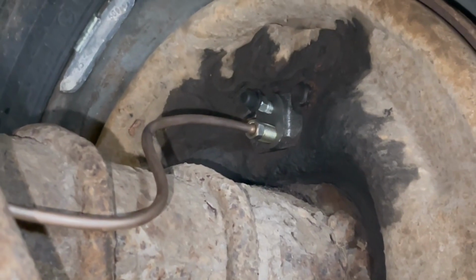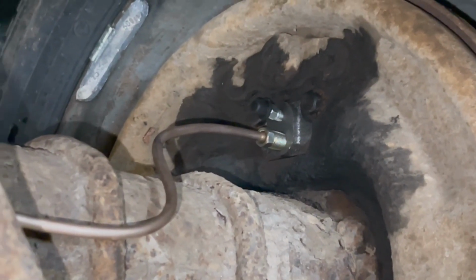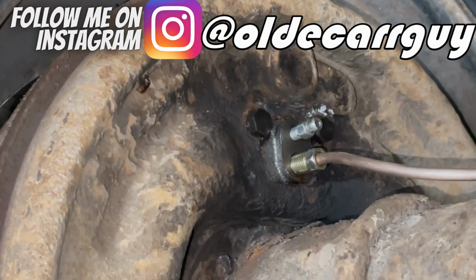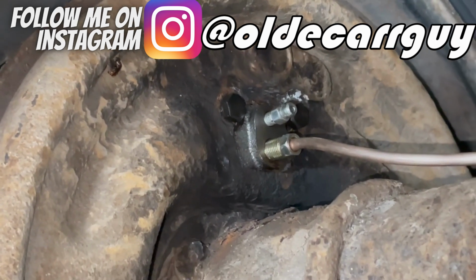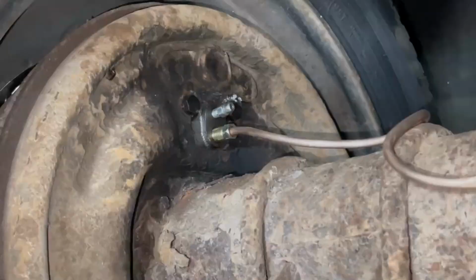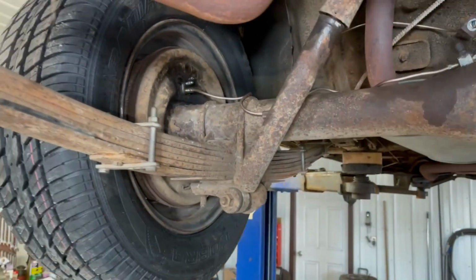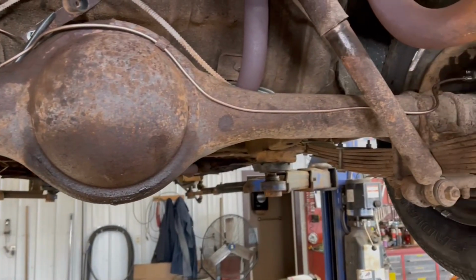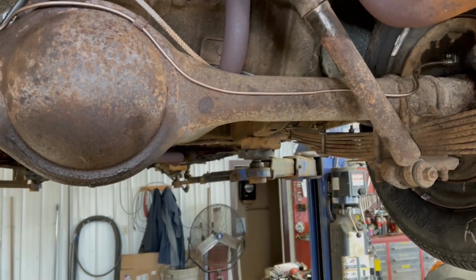Dad got yesterday. So we managed to get the new wheel cylinders in on the back and the brake lines run. If we come over to this side over here, you'll see the same thing. He's got the new cylinder that was there because that was the only bleeder we couldn't crack open initially when we first started working on these brakes. The brake lines are in, and we did use the Nicopp brake lines because, like I said earlier, they're so much easier to work with, easier to bend up.